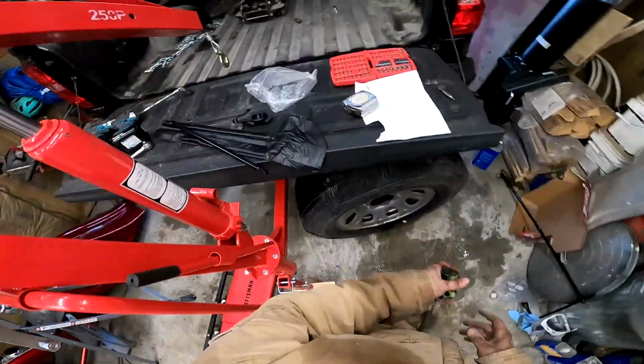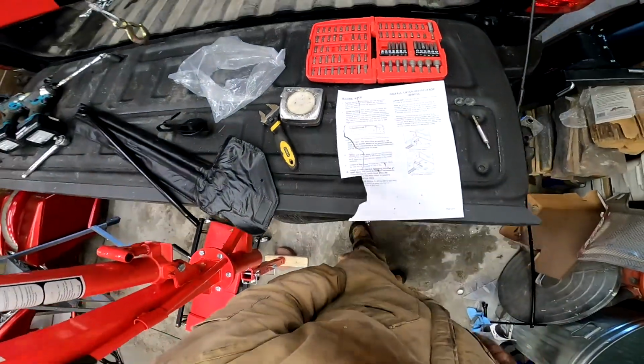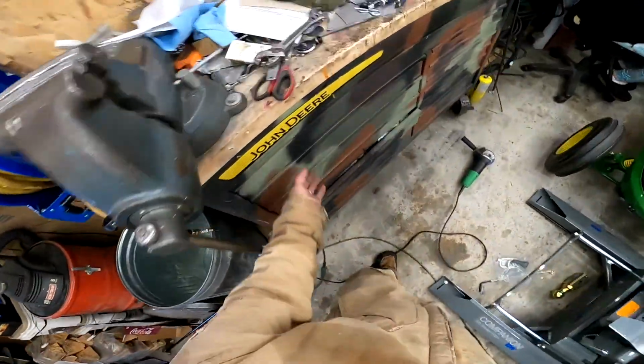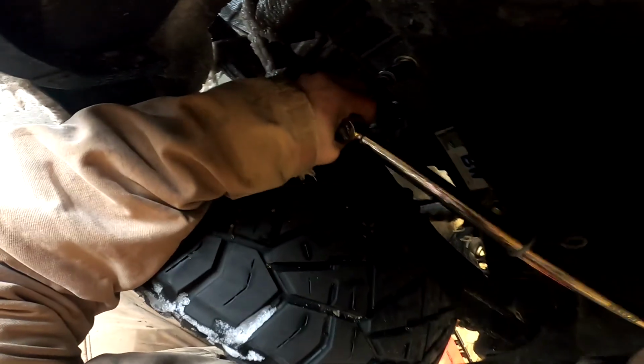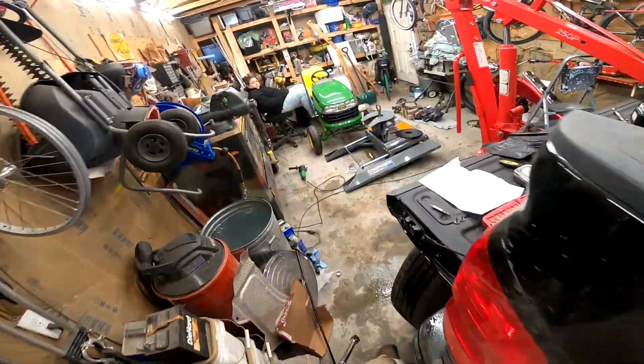So everything is tight now. However, it's not tight. Now I need to torque all fasteners. All the 1/2 inches need to be 110 foot-pounds, and these 16 millimeter ones need to be 150. So I'm waiting until the handle clicks. Once the handle clicks, I'm there. Oh, we're almost there. She's getting tight. There we go. All right, those ones are done. On to the next.